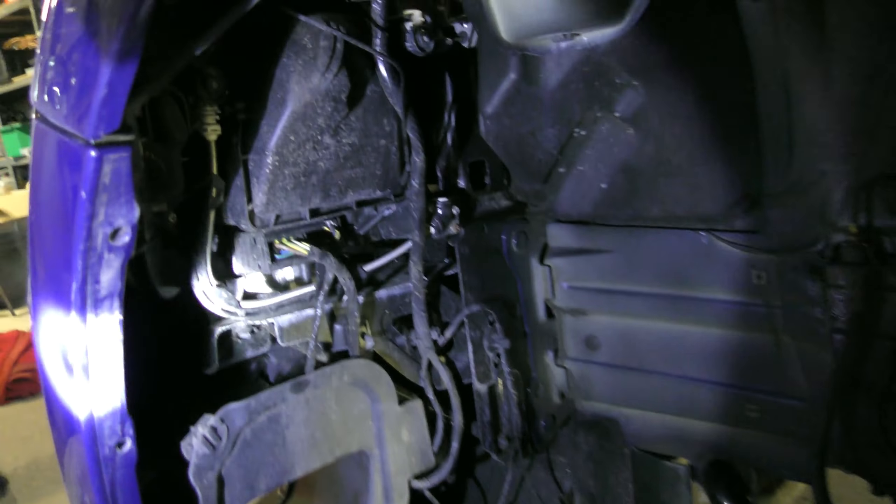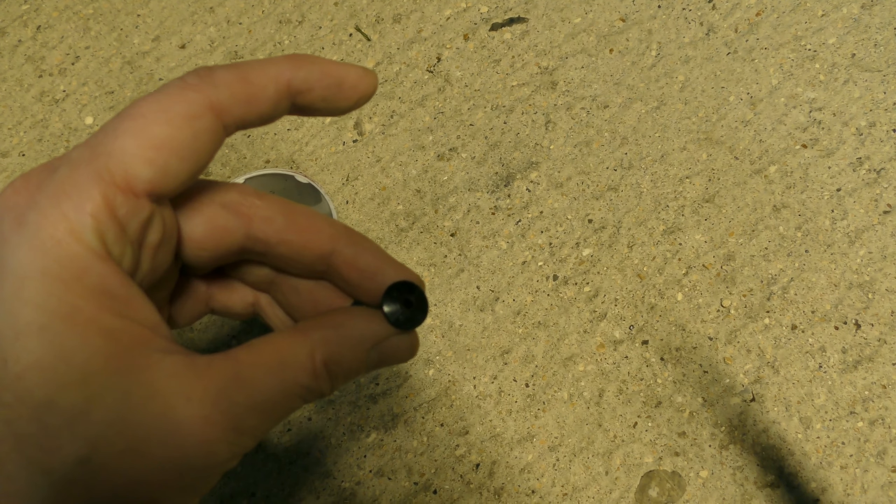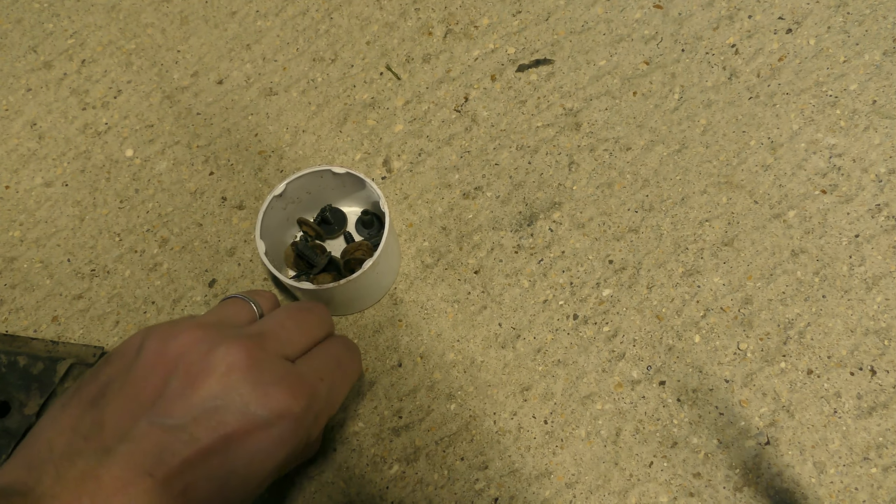When doing DIY you should never rush things — and I already broke one of them because the first time I didn't really know what I was doing. You can see the crack there all the way up where I've cracked it by being an idiot, so I'm going to have to either fibreglass-bodge repair it or get another one. Also, these little plastic-on-plastic fixings — they look like you just get pliers around and pull them out, but there's actually a little pin in the middle. You have to push the pin all the way through into the bumper; that allows the clip to release. I just forced them out and broke half of them, which is really annoying.